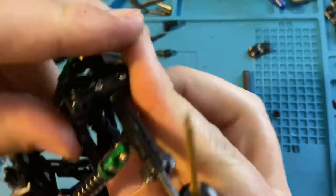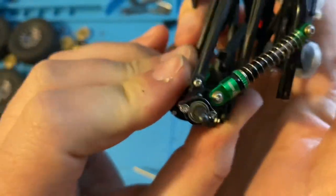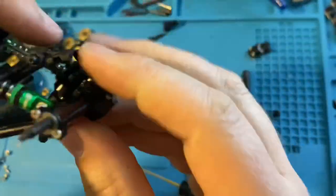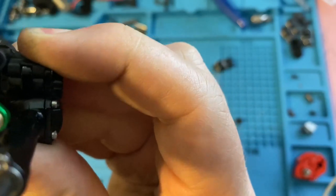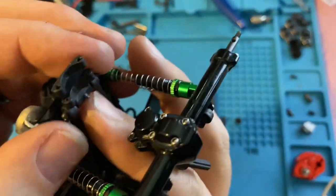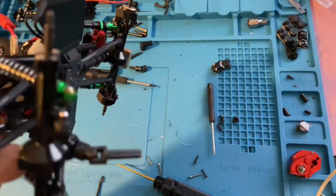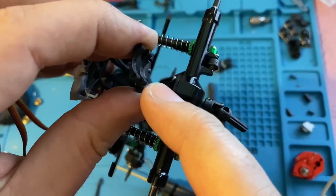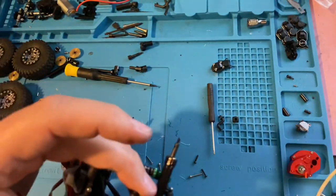It does not hit. As long as we're not hitting the driveshaft — it looks like we are safe on the driveshaft. It is very close though. Just because I don't like things touching things they're not supposed to, I'm going to clip the very end of that off, just a tiny bit. And we still have a little bit extra, but remember we're all the way in, so we're going to be backing it out to fit the limiting strap. So let's go ahead and back it out now.